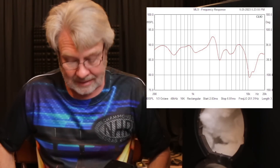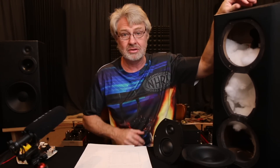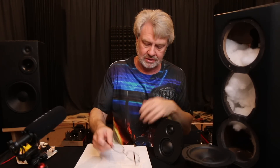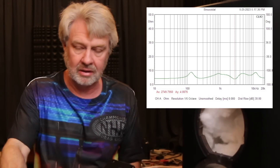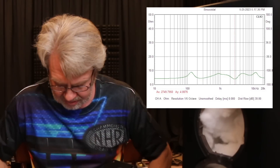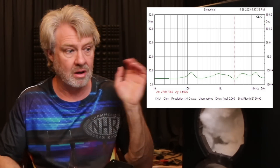We laid the speaker over and took some measurements of the Atmos speaker on top. I'm not even going to take this grill off — it's a little coaxial speaker. Looking at the measurement, yeah, it measured kind of rough. It actually measures best if you leave the foam ring and accessories on it; take that stuff off and it measures even worse. The impedance on that is also a fairly low impedance load. Be sure your receiver is set to handle four-ohm loads, because this thing is a four-ohm load all over.